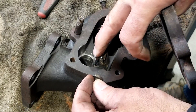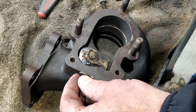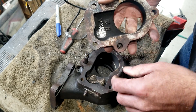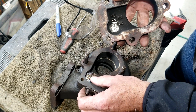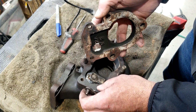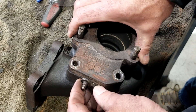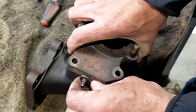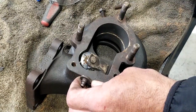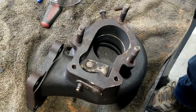Since I've added a little thickness to the arm, I need to make sure that it can open far enough to allow good flow. So I took a chunk of metal off right here where the top of the wastegate arm hits the backing plate. That should offset at least the three millimeters I lost by adding additional material. That's my full open — opening any more than that doesn't make any difference. The hole is the restriction point, so I feel good about that.